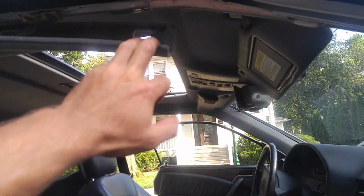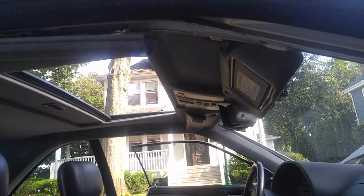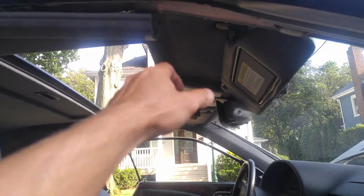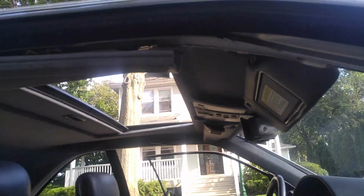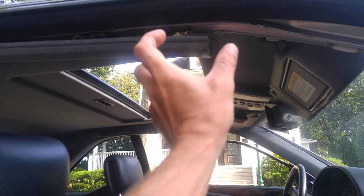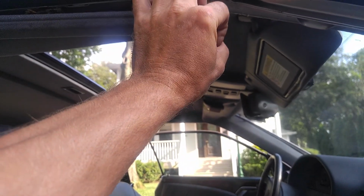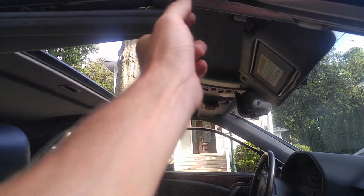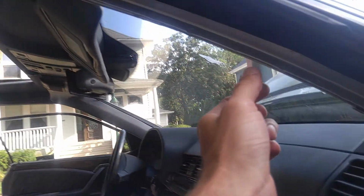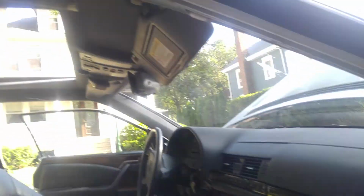Since it's all removed here, the water starts gushing out right at the broken spot. The problem here is that you can't get to it. You have to remove the headliner, and then you might have to remove the whole sunroof frame and get those little pipes reattached again. And they most likely just disintegrated and fell off. So the drain spigot is still there, but the rubber hose is supposed to connect onto the spigot and let the water pass inside this A-pillar. There's a pipe inside, and then it goes down inside there, and it leaks in this area right around here. That's where it should have leaked, but it's leaking, as you see, straight out here.